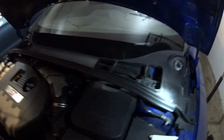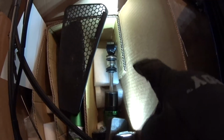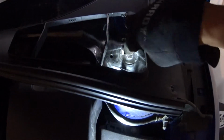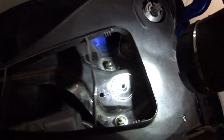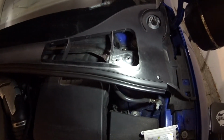Another thing that I actually wanted to talk about here is that these coilovers are adjustable, and in the rears they're adjustable at the bottom here. So right there, right in here, that's the adjustment, and that's oriented the opposite way. So that's the bottom, this is the top, and at the bottom that's where the adjustments happen. Now here on the front, the adjustments are on this strut tower brace. So it's underneath here. If you look straight through this screw hole right here, that is where you will essentially find your adjustments.